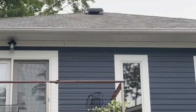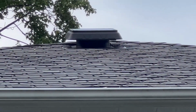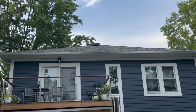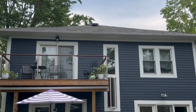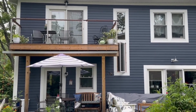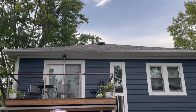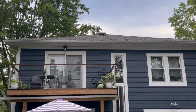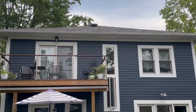Okay, well, that part's done. I think she's going to be watertight. I'll be checking in the next rainstorm. I'll put some newspaper down below it. Just got to do the electricals, but at least right now it's a hole and air's coming out. So it's 750 cubic feet per minute at full speed, and I figure it's about 10,000 square feet. So it should be 18 changes. Every 18 minutes it should change the entire air or something. I forget the math, but it's going to help nonetheless. And it's a big hole.